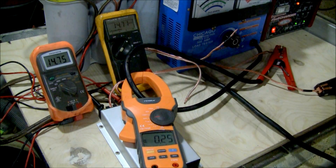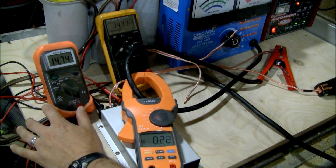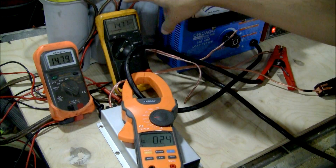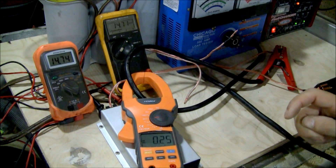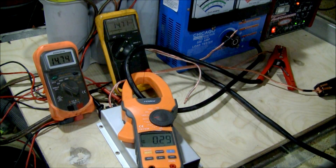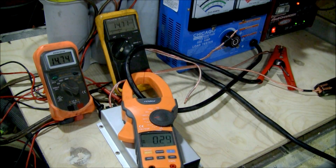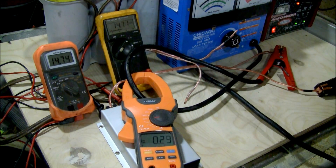In this test setup, we've got the current clamp right here. This is the voltage for the cap itself, and the yellow meter is for the battery itself, so you can actually see the difference of what's going into the cap and into the battery with draw. I've got a load tester right up to 500 amps and an Excess Power IntelliCharger that is set to 25 amps.